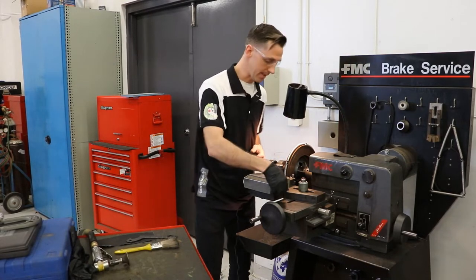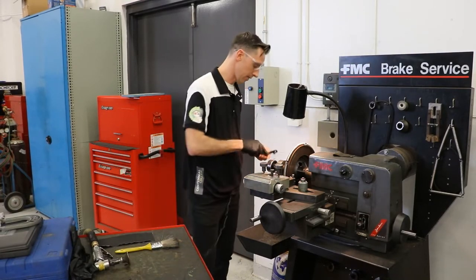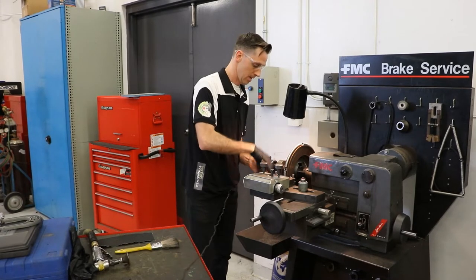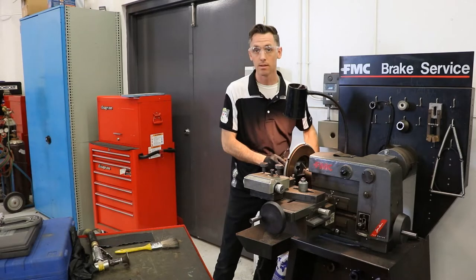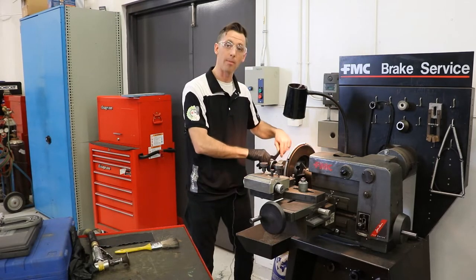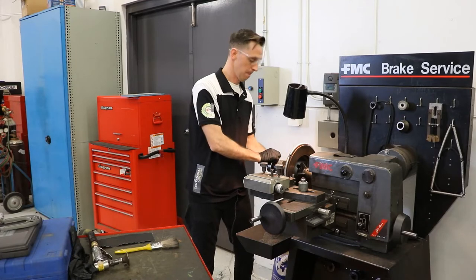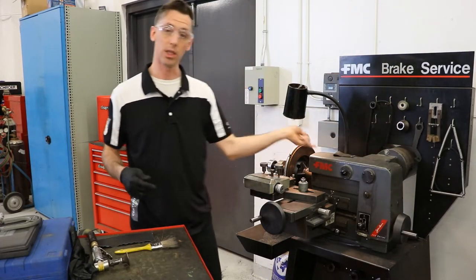So what I'm going to do is test whether it's me or it's the rotor. I will loosen off the nut and turn the rotor 180 degrees while holding the adapter. Now I'll tighten it up again — remember, it's a left-hand thread. And I always want to put my tool away so it doesn't vibrate while it's sitting on the machine and go flying.